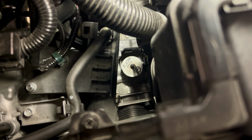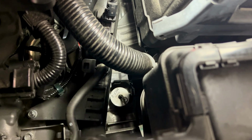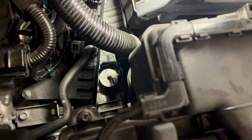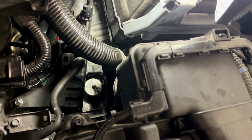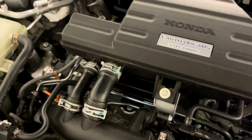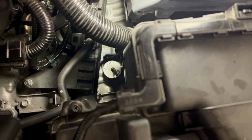If you can see, the plug is actually a little bit dirty, and all around there's a little bit of dust and whatnot on these parts, right? So I'm just gonna clean it. The reason why, obviously, is if you take that plug out, you don't want any debris, any dust particles, sand particles, whatever, going into the oil, and that's obviously bad, right? That's really the reason why you want to make sure that your engine compartment is nice and clean. Places like this, you see all that crud, right? That can easily get into the transmission or the engine oil, so you really want to keep your areas clean. And I'm gonna wipe that before I loosen that off.